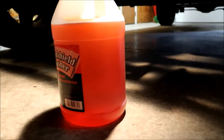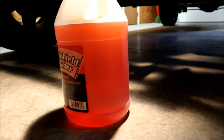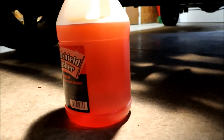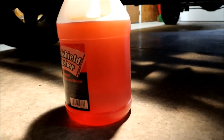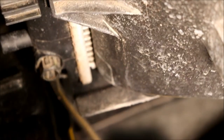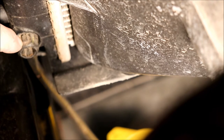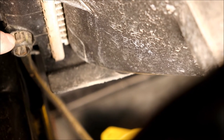That's all I got out before it started spitting air. There's definitely a difference in color here, and we'll take a look at the shutoff for the petcock. When you close it, this mark should be at the 12 o'clock position and you can feel it kind of goes into a detent. As you spin it back in, it'll get a little more difficult and then fit into a detent — you'll feel it kind of stop. Don't go any further than that or you'll twist it off.